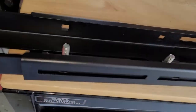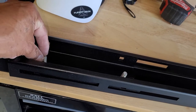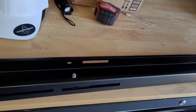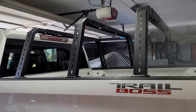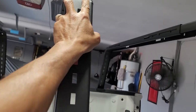I've got it upside down on the table with the bolts already in there. Having it upside down helps keep the bolts in place — since they're slotted they won't turn, which gives me the opportunity to hand-tighten everything once I get the washers and nuts on. I've now got the three supports mounted on the truck — they're loosely mounted but there's no side-to-side wiggle room on any of them.